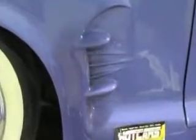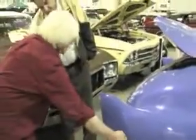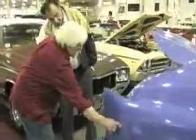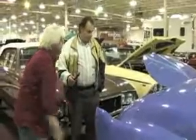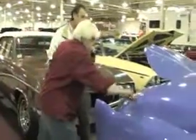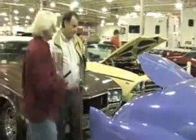Let's take a look at the back. I noticed that you've got some new detail in the wing area. This is actually 50 Cadillac from here to here, and I welded it right into the Chevrolet fender. I tucked the fenders in a little bit and added this gas door — the gas door is actually from a Volkswagen. And then I added another four inches on here. It used to come all the way down here — I welded that shut. This is like a pancake trunk, and it operates from here.